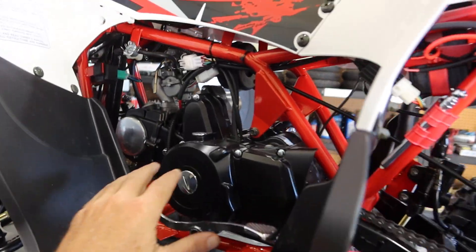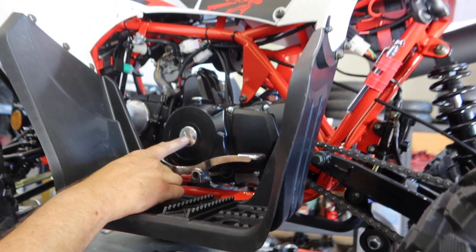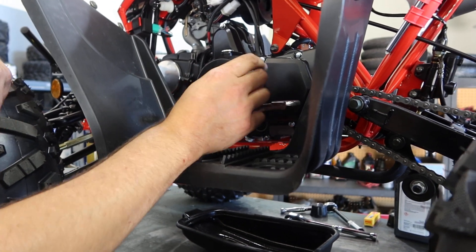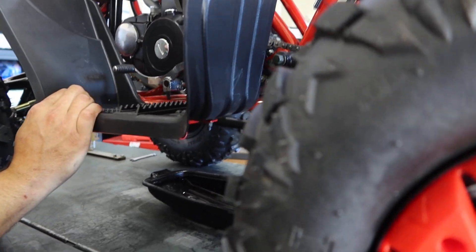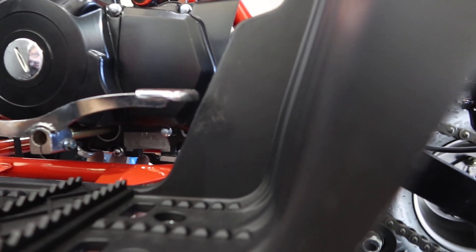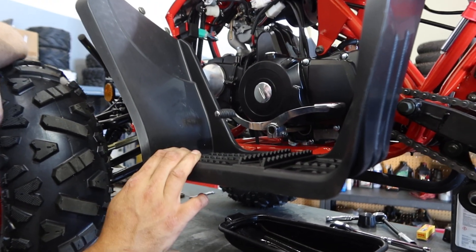A lot of customers ask what's on the left side when you're sitting on the ATV. This little cap here is just for timing — you don't pour any oil in it. It's also to hold the stator still. You remove this with a 14 millimeter socket. This here is the chain cover area and your starter area. As mentioned, for the oil change you're looking for that vertical bolt on the other side; this angled one you do not want to touch.